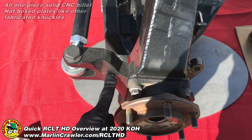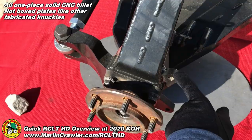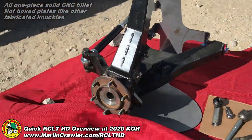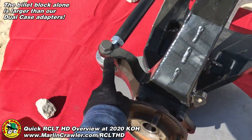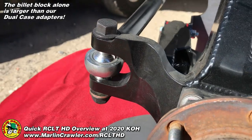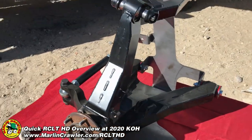We've got double shear — this is all one-piece billet steel, double shear to the wheel bearing and also to the brake caliper. It's all one piece. No plate steel at all for all that steering. We've now gone from a half-inch bolt up to a five-eighths inch bolt for the double shear. That's five-eighths inch hardware on that heim joint — some beefy steering there.